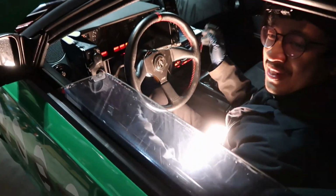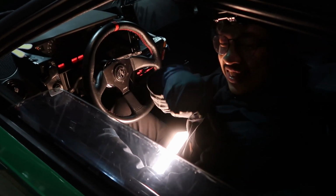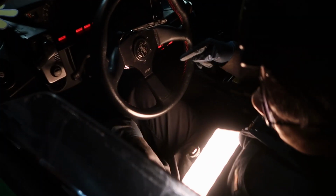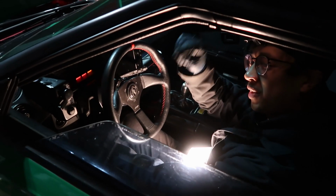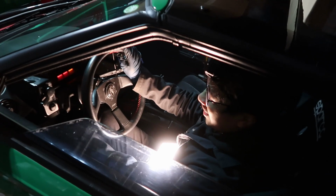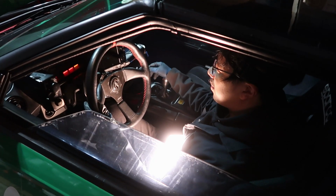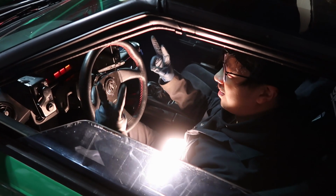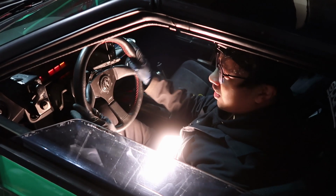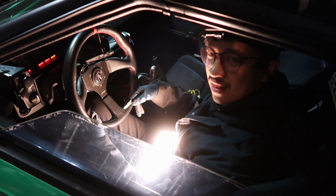Okay. Well, first thing first, I'm gonna take off the wheel. I'm gonna take off the seat so that we can access the little U joint on the bottom steering joint. I'm gonna mark those up and then pop the outer tie rods, and then 4 bolts for the subframe thingy, and then 4 bolts for the steering rack. It's pretty simple. So it should take, like, 5 minutes. Good thing you came over at 7.